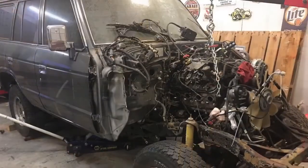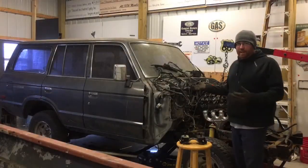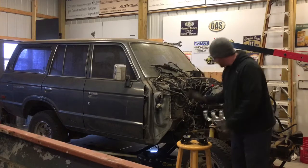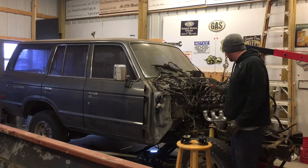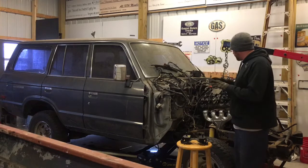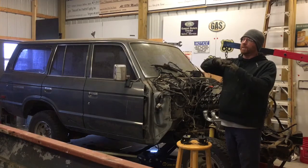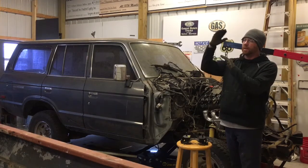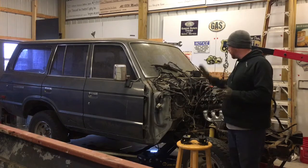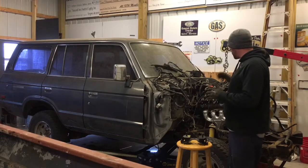Basically going to pull the engine back out. My plan for today: I've got to mount the transmission transfer case crossmember mount onto the transfer case adapter from Advanced Adapters. I've marked a couple places on the fuel line where I'm going to need to cut from the factory rail that runs down beside the trans. I'm also going to build a bracket that will move the fuel line up just a little bit tighter to the floor pan, to move it away from the shifter to where it'll meet up with the fuel rails. I've only got about three hours today so I'm not going to work super long out here.